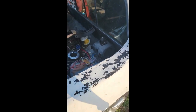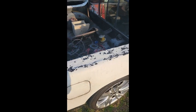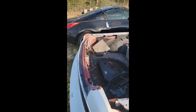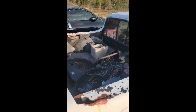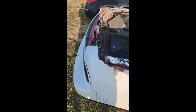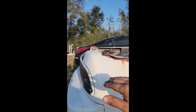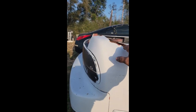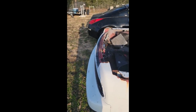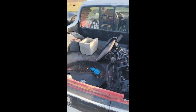This isn't hard work — I can cut this out, re-bend and roll it in, and it'll be just fine. I don't necessarily need to cut everything out, but I need to find the weak areas and cut out that stuff before it becomes a problem later. On the inside of that quarter panel the metal looks beautiful — it's fine. It's just some of this other stuff and the edges we have to work with. On the tail section, you can see where it curves up to meet the hatch — we're not going to leave that. We want it flat all the way back, so we'll have to cut and adjust that.